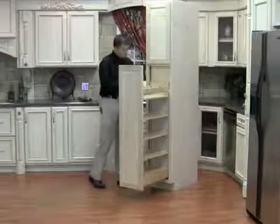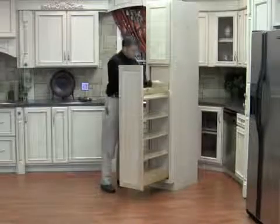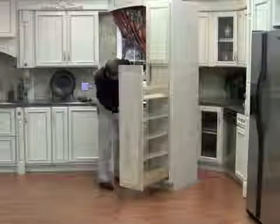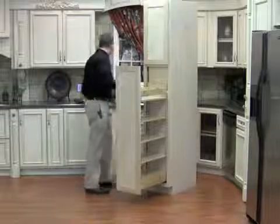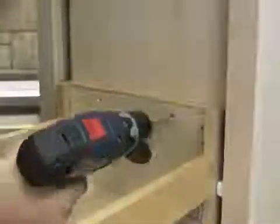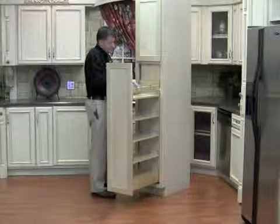First we'll begin by removing our 2 cover stickers so we can access the screws. Then we'll go below here and loosen this by 1/4 of a turn. Then we will take our drill and remove these screws. Once your screws have been removed, you can start to slide down your back panel.